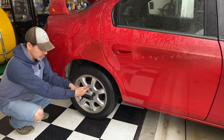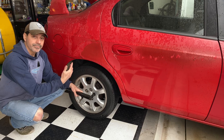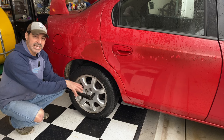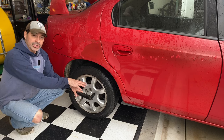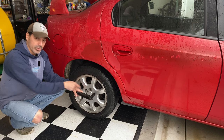I'm going to get a close-up so you can see how it looks in there. We're going to saturate it with some penetrating oil. I've already put penetrating oil on these a couple of days ago, a few times, and let it sink in. If it's really bad, you want to let it sink in at least 24 hours to really get into the threads and into the nut. I'm just going to show you the application here, what I did a couple of days ago, and then we'll continue on.